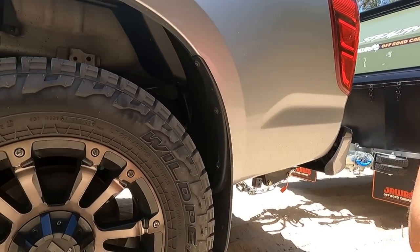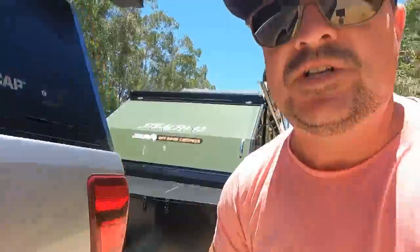About to hit the beach entry where Mavo's going to drive. We're just airing down. Now, I just wanted to quickly talk through the van because I was thinking the other day that when I say I'm going to go to 30 in the van, people might think that 30 is a bit high. Everybody traditionally for the beach goes to 18, 20 PSI. The reason that I only go to 30 is because we've got a single axle van.